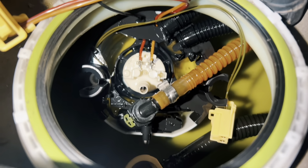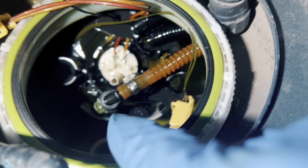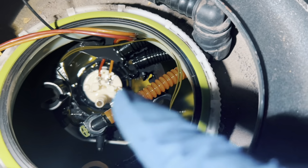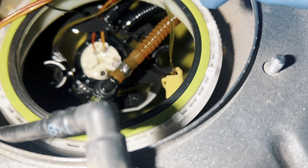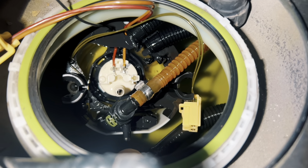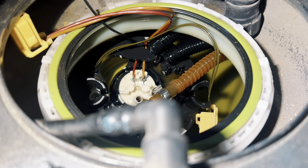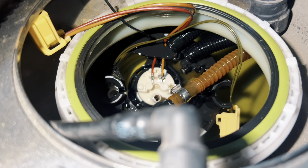All right, another update. There is this green connector that goes to the top of the pump. Green connector. That's just gonna get pushed in, and then you're able to pull that orangish tube out. There are these two black tubes that go in these two little clip tube holders down there, and I believe those are just return lines. But now I have everything disconnected. I, in theory, should be able to pull out the bucket and dump the remaining fuel back into the tank.